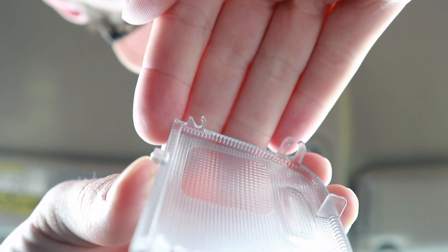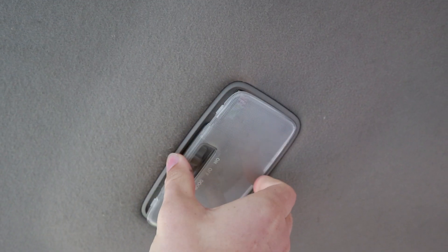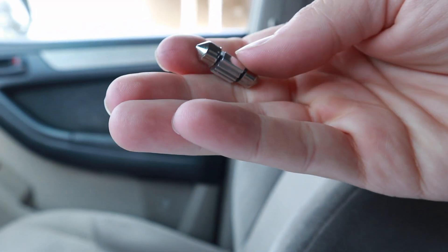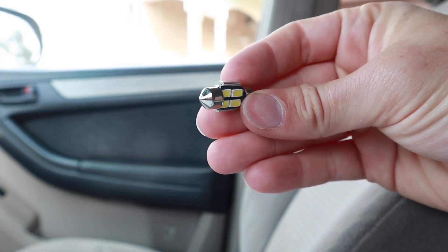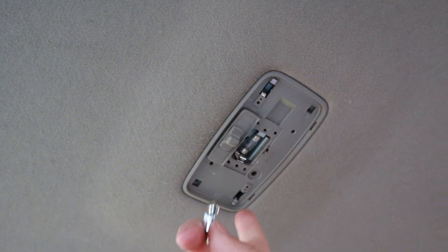For the inner one you want to slide it in and then push it up. Next you're going to have your center dome light — it sits in like that, so you want to get your tool, wiggle it in there, and it'll come down, then just pull out because it slides into these two tabs up here. This is what the stock one looks like versus the new one. It's only one side so the heat dissipates on the other, and when you put it in you can toggle it to where you want it to point the light. I'm probably going to have it pointed back so it's not blinding my point of view.